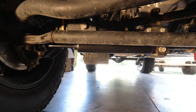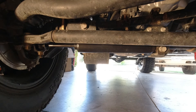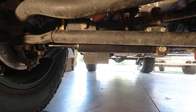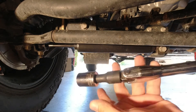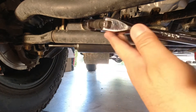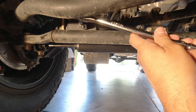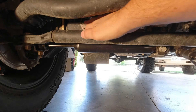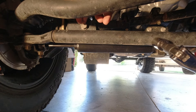On this 2018 JL, a lot of things under here are going to be 21 millimeter, and I think that's pretty much universal for most Jeeps. Older ones will be different. They use a flag nut on the back side so you can access the front. I'm going through with a breaker bar, small extension, and 21 millimeter socket to reach through and check if it's tight. This is where it came loose on us when we were down at Turkey Bay OHV — my track bar came loose and I didn't realize it.